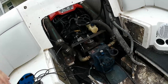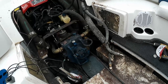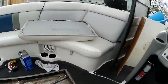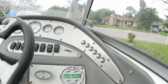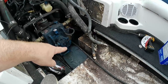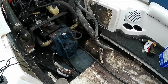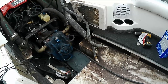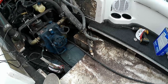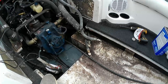First thing we did was run the wire all the way to the helm. I just ran it back through where all the speaker cabling is — we'll zip tie it up later. Used the old fish wire trick and it just comes out right down there where we'll install the gauge. I cleaned, acetoned, and sanded that little patch right there — that's where we're going to install the transducer. The next step is to get this marine adhesive on there, clean it up, and get this thing glued in, and then we can start working on the gauge cluster.